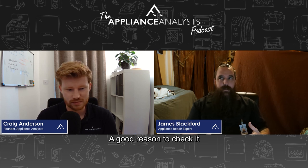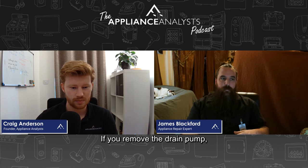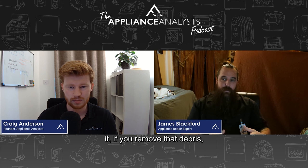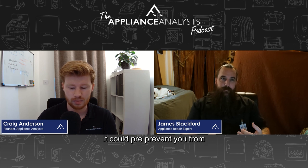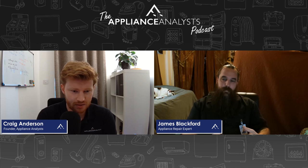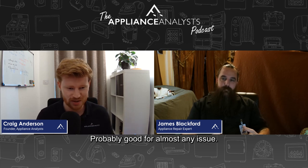A good reason to check it if you start hearing it: if you remove the drain pump, sometimes there's actually some debris in there. So it could be a little piece of glass or something that's just not able to go through the drain. And by at least checking it, if you remove that debris, it could prevent you from having to replace the drain pump. Yeah, getting in there and having a really good check. Makes sense. Probably good for almost any issue.